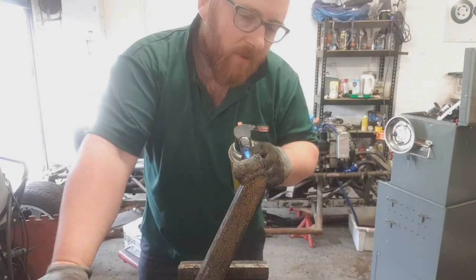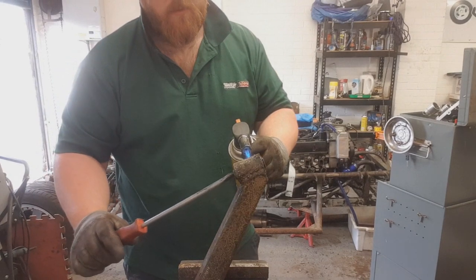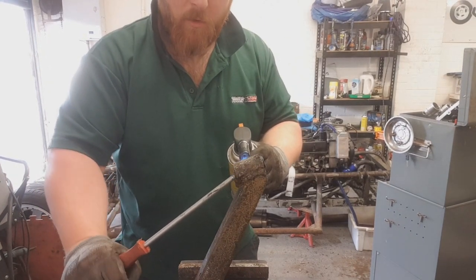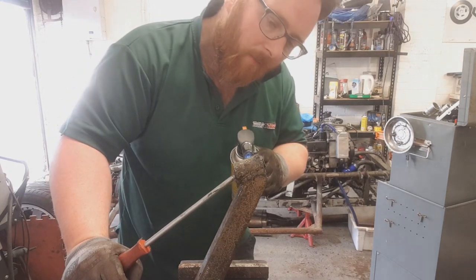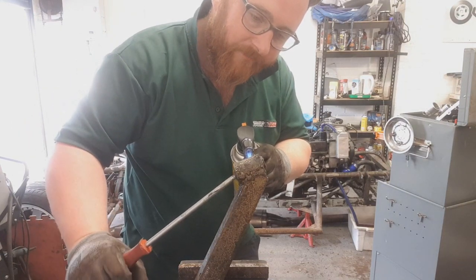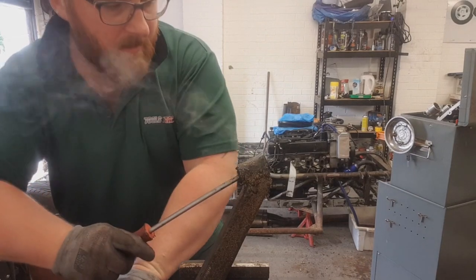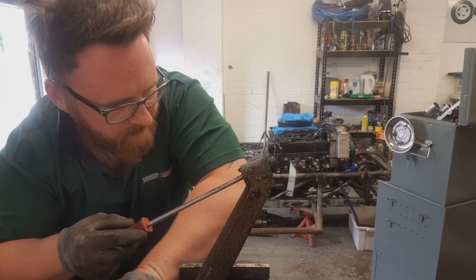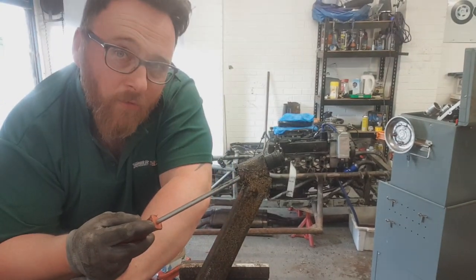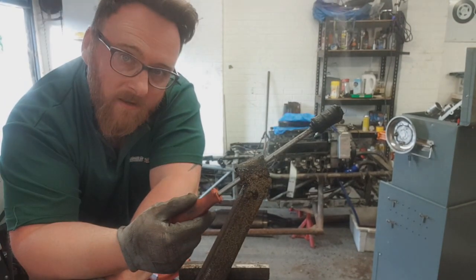Now when you're taking these bushes out, you don't take them out in a big ball of fire. You will hear crackling of the rubber starting to break down. If you put a screwdriver in, push down on it and twist, it'll start to move more and more. It will get to a point where the rubber breaks its bond. Once it starts doing that, push down, twist and lever it out. No flames. Doesn't smell great - probably best not to breathe some of that in.